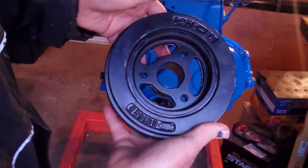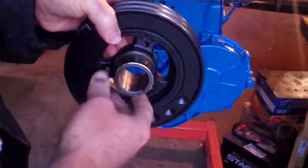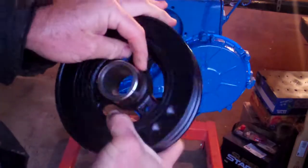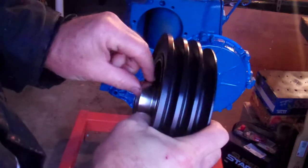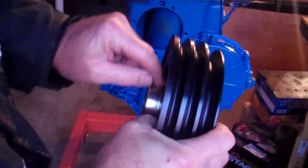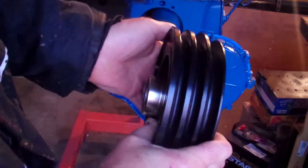So I'm going to put that back on there. I'm going to put some motor oil in here. I had to put a sleeve on it — you can see that sleeve there — because there is a groove worn right in there from the neoprene on the timing cover itself. Just wore a little groove there, so we put a sleeve on to take care of that problem.